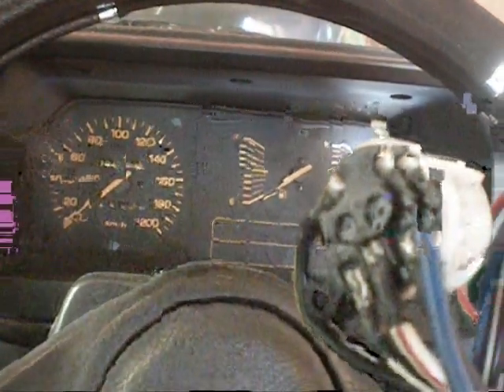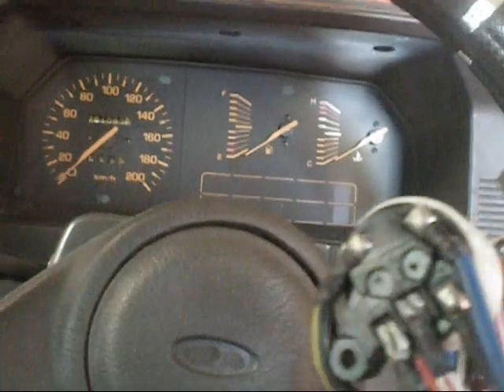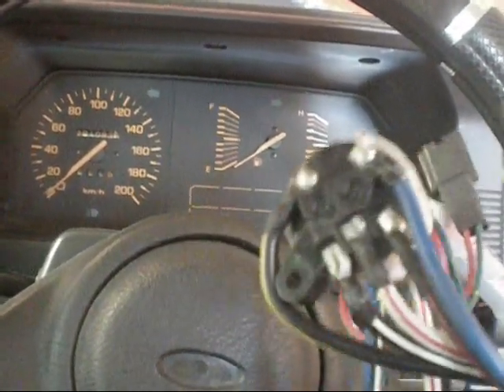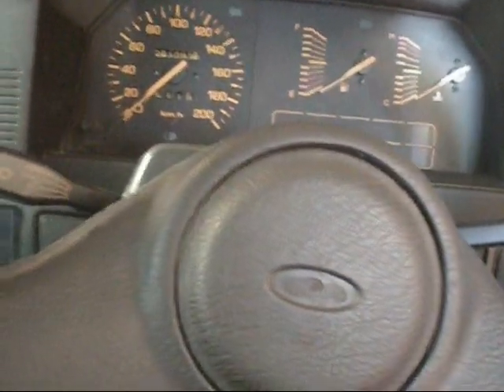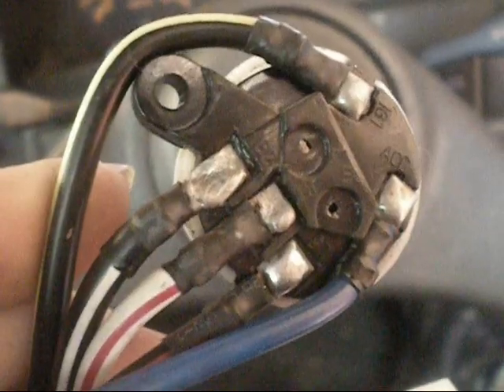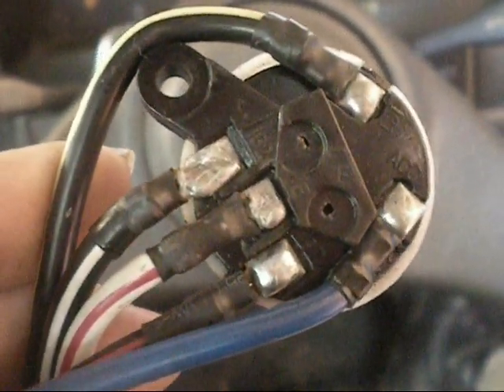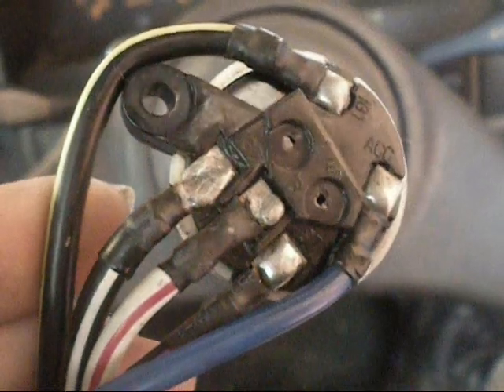It's actually quite common in these. Because I fixed the air conditioning, all of the radiator fans and everything run through this switch, and it's melted it. You can see the two solder joints that have got toasty and hot, so you can imagine what the inside of the switch looks like.